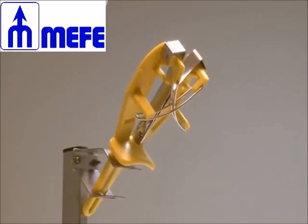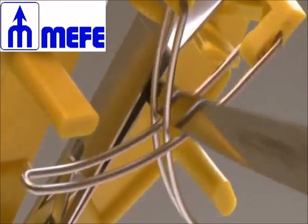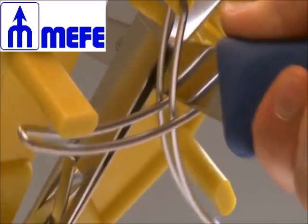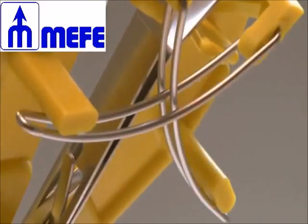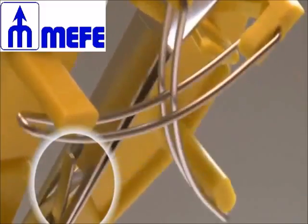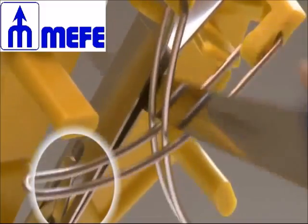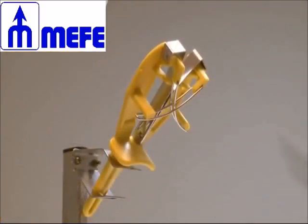Daily maintenance of the cutting edge: insert the blade into the guide up to the hilt. When the blade comes into contact with the pretension guide bars, slide the knife from the hilt right up to the tip with a gentle and regular stroke going down inside the guide, without reaching the V-shaped tongs situated at the bottom. This movement should be repeated several times in a row.